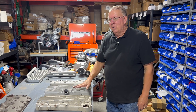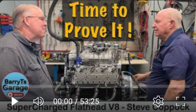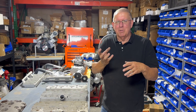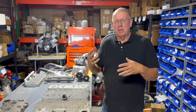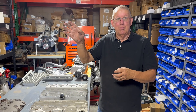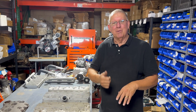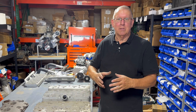One of my primary hobbies is building supercharged flatheads. From our performance video on flatheads, we talked a little bit about the chamber — the chamber in the head where the valves have to come up into. The size of that needs to be bigger for a supercharged application. It's better to start with a 7 to 8 to 1 compression ratio and have room to supercharge. But on a naturally aspirated engine, you're trying to get the compression up, so the chamber is smaller than a stock Ford head.